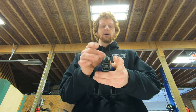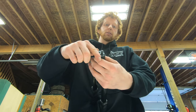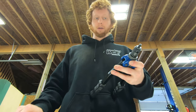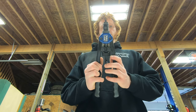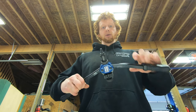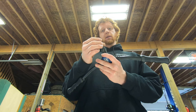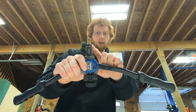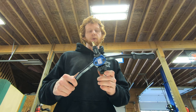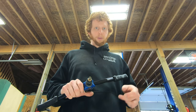There is a thread cap on the top which acts as a stop, and it comes with a little wrench. Hold the knurled pieces and just snug it up. So we are set up now for the rivet to be put in place. This is the compressed position that will pull it and cause the rivet to do the rivet action, so we don't need to be in that position just yet. We expand it out and thread our rivet on — it's important to leave a bit of a gap so you can start applying force without it being cumbersome to put in place.